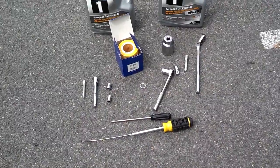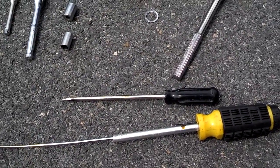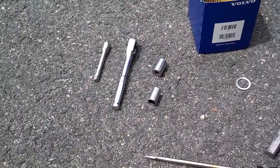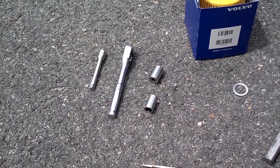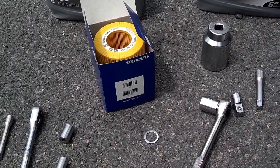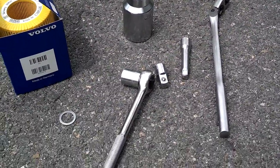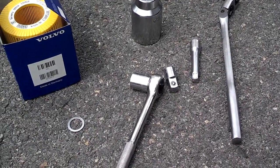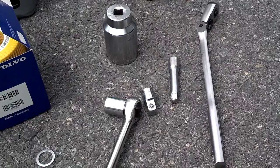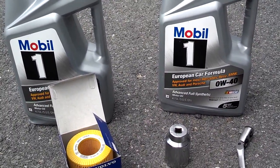Here are the tools and equipment I used to change the oil on this XC90. I have a magnet to fish the drain plug out of the oil pan once it's full of oil, a screwdriver to knock the crush washer off, quarter-inch tools — 10 millimeter, 12 millimeter — and a short extension in case you have the splash pan under it, which this one didn't. A new crush washer, a new oil filter — I only use OEM style oil filters. A 36 millimeter socket to remove the oil filter housing, two 3/8-inch ratchets (long and standard), a 17 millimeter socket for the oil filter bolt, a 3/8 to 1/2-inch adapter, a short extension and a long extension. And two gallons of oil because it calls for just about eight quarts.